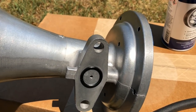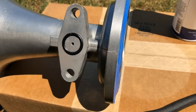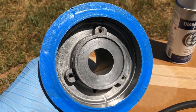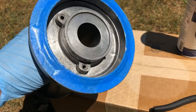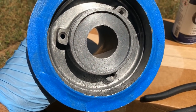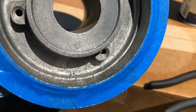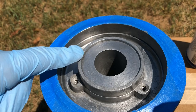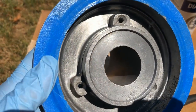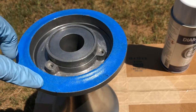Some people will tell you that you have to mask off every machine surface, and they would normally tape off the entire base of what I call the foot of the horn. This is not necessary on this type of horn since it does not have direct contact — the only area that's going to actually have contact is where the rubber O-ring is. Water does get up underneath in there between the manifold and the horn, so I wanted to keep that from getting corroded. I also paint the inside of the power chamber, as this is where most of the pitting occurred and I don't want that to happen again. I also recommend using latex gloves to keep fingerprints and oils from getting on the horn parts before painting, as this can mess up the adherence of the paint.